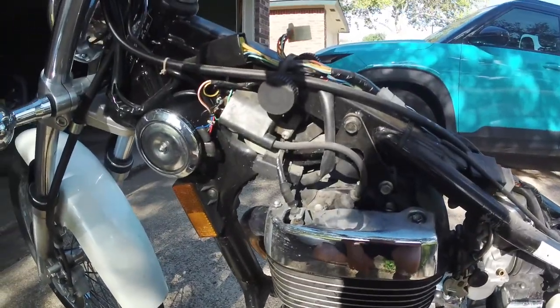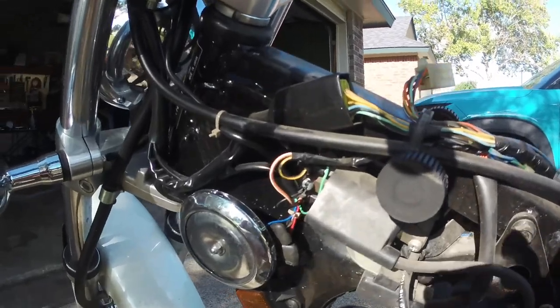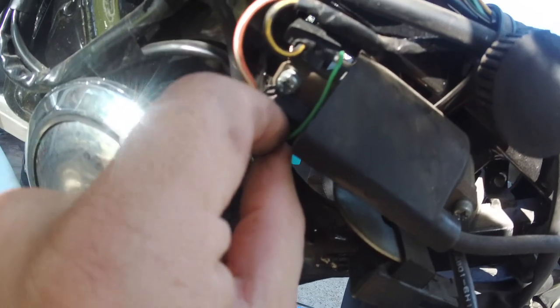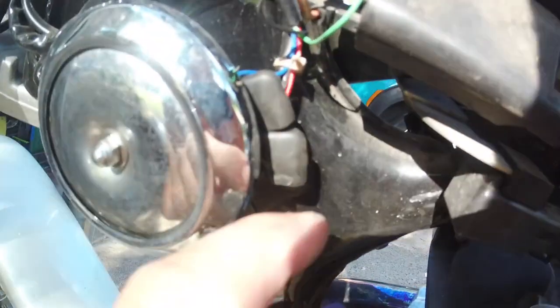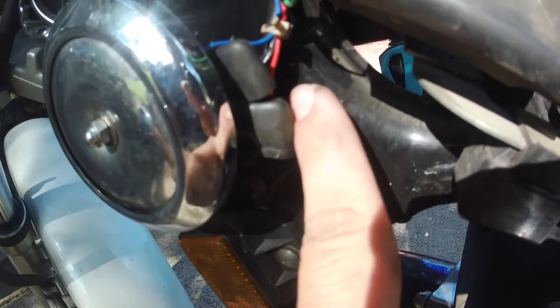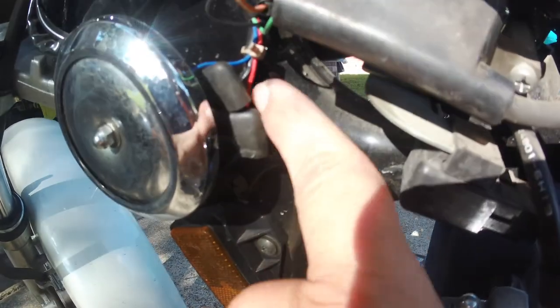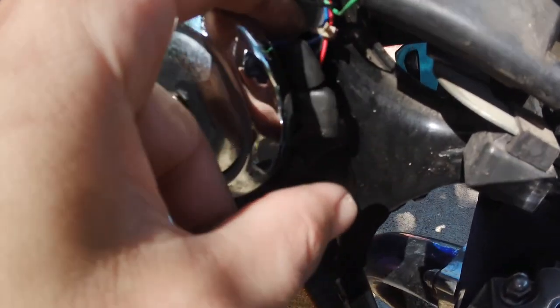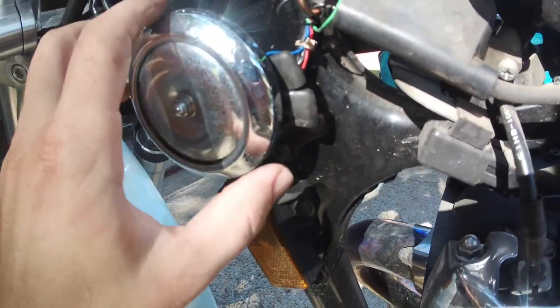So that's it. Again, you've got four wires coming down right here. Your black is your ground, your green is your timing, your blue is either your power or your backlight, and then your red wires in right next to the red and black for the horn, and the blue right next to the blue and black for the horn.